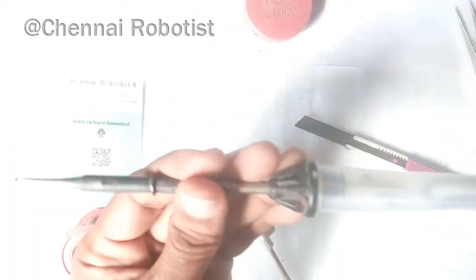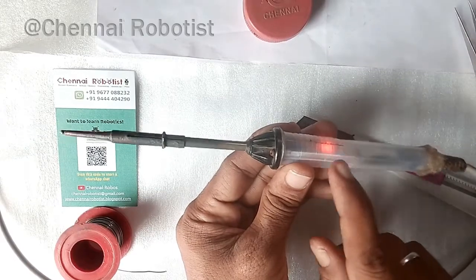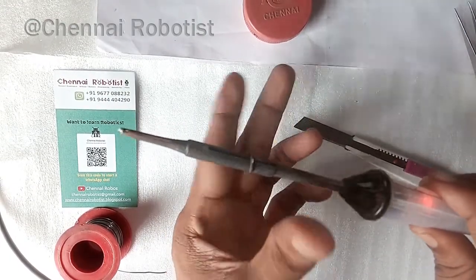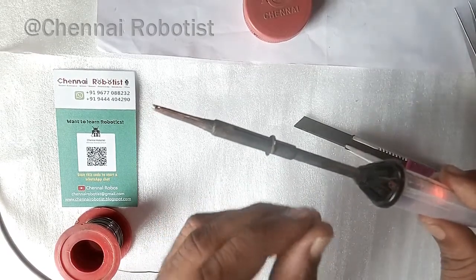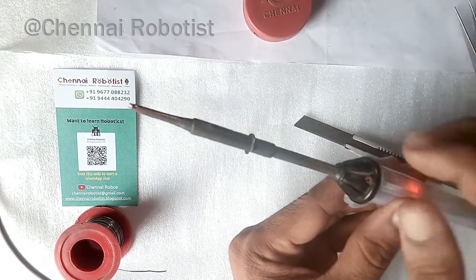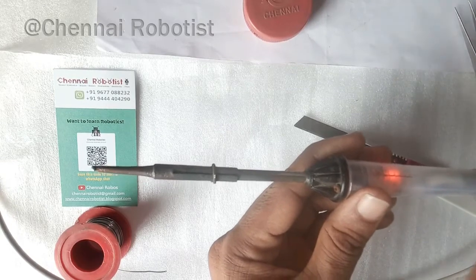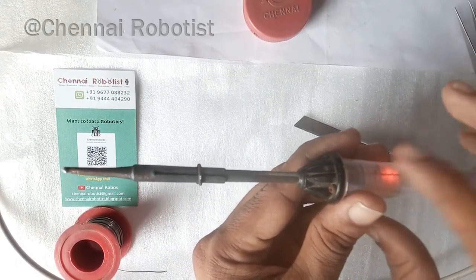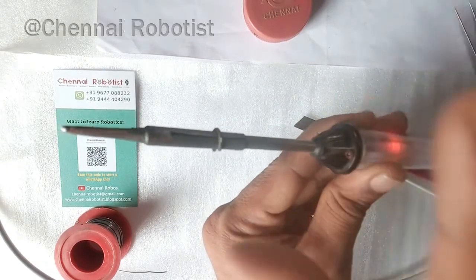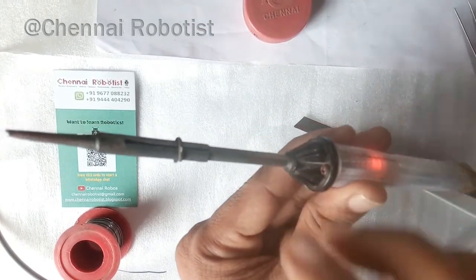I've plugged the iron in and you can see the indicator light glowing. Be very careful — if you want to test for electric leakage, use a tester on top of the iron. A faint glow is normal, but if the tester glows brighter you need to check for short circuits or electricity leakage inside. To check if the rod is heating up, you can gently tap it — only do this if your foot is on the floor mat.